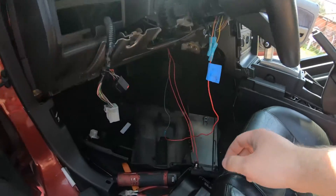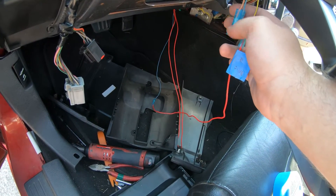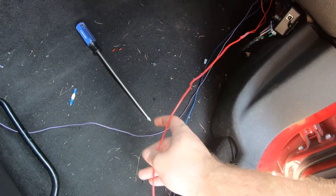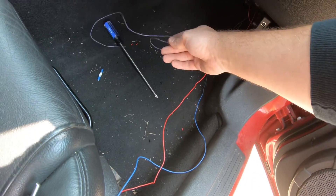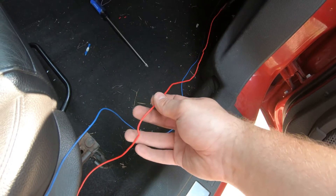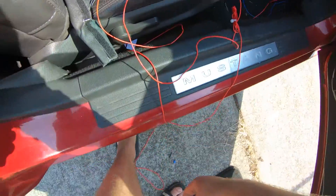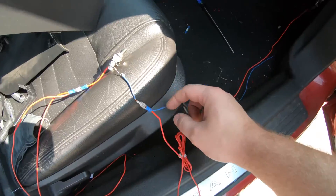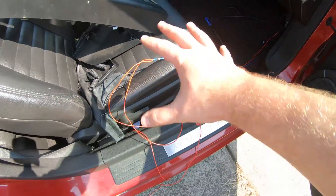Little update: I got the line from the computer for the right pin — pin six power. Then I have these other two: just the ground and the left power. This is where it gets a little complicated. This red line goes up here and tees off into two for both computer grounds. Then we have the other blue line — you can disregard a different line which is for a trans brake. So just these two lines: the one that splits into the two grounds and then the blue line. The one from the computer grounds comes down here up into another T that goes to one of the prongs on the switch, and the other goes to the left power. Then the blue line from the computer comes up and tees off, and then goes to the ground.